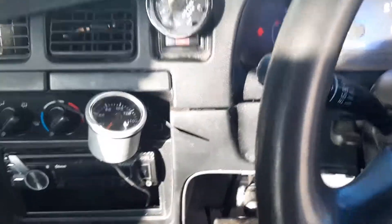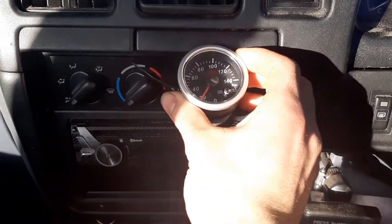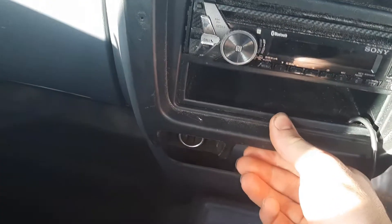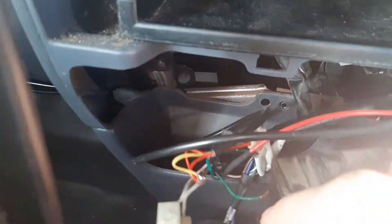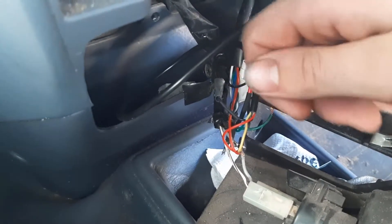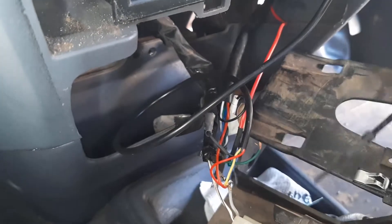It's just cable-tied for now - and when I say for now, it'll probably be cable-tied for the entire time I own the car. To wire in the gauge you've got to find a switched ignition source positive. I've pulled mine from the cigarette lighter. The wires from the oil pressure gauge run down through here - the red and yellow: the yellow is switched for the light on the gauge. I just pulled them together and got them both onto the positive, so when you turn the car on the lights come on on the gauge.